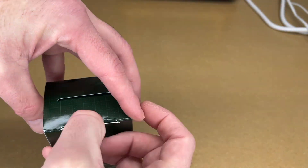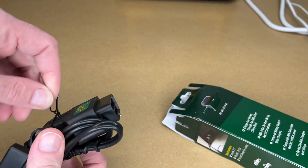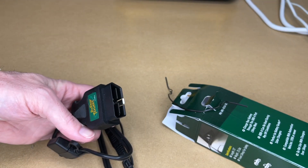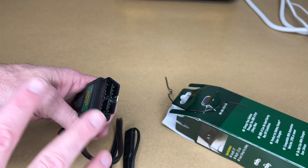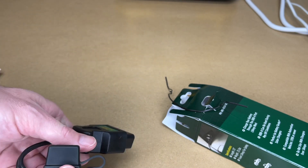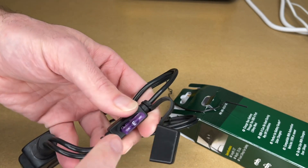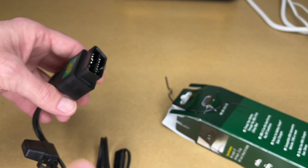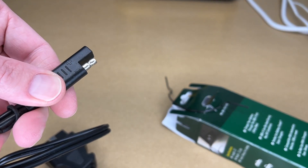Let's open this up. Here we have the adapter. I do want to say I don't know if this could damage some cars, so use this at your own risk — there might be cars that don't like having power back-fed through this port, so research that on your own. This will plug into your diagnostic port. There's a 3-amp fuse inside here, because the power pins are not made to carry a tremendous amount of power. And here is the SAE connector, labeled plus and minus.